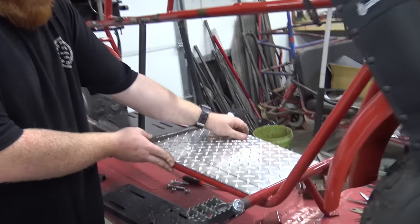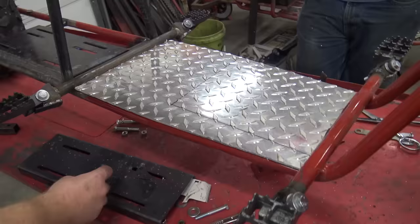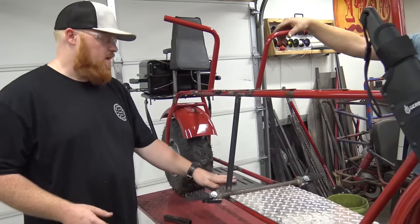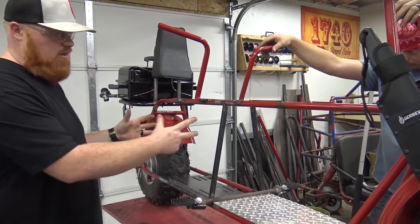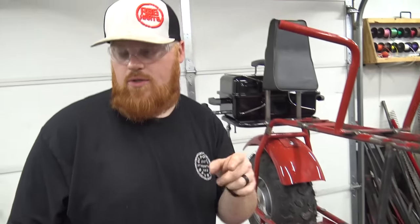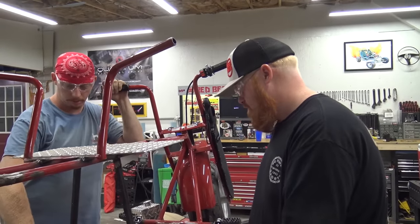There's the floor pan — looks sweet. We can do the gussets bolted on the bottom side, tack them on, then drill the holes. This build has really come together. We lengthened the frame in about four hours and had it as a rolling chassis in four hours. The engine plate took careful work to make sure it's exactly centered on the frame and the chain lines up good. We used one-inch risers under the engine to clear the torque converter, and I still had to trim the torque converter. Merch pre-sale is going on right now — hats come pre-stained and sweaty for $20, t-shirts for $12. Link in the description below.